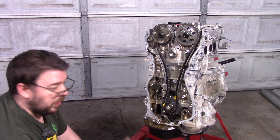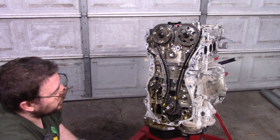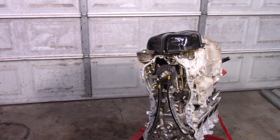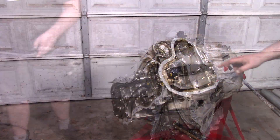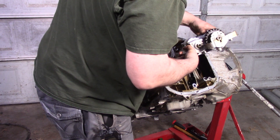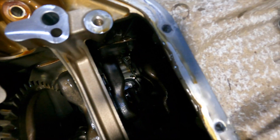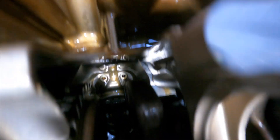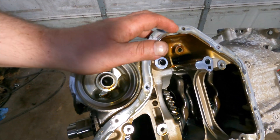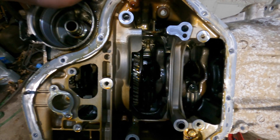Let's get the pan off. By the way, if you're not taking the balance shafts out, you can stop right here because everything you need is up here and you'll need to re-time the motor afterwards. Technically I think you can re-time it with the timing cover on, but don't — we're going to be doing enough monkeying around here that it's not worth doing it that way. And this is officially out of time. Let's take a look in here — the big thing I notice is those oil squirters down there. It looks like the 2AR FXE still has them all, so we're good there.